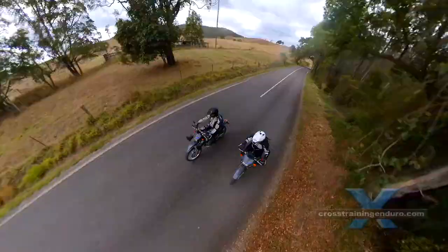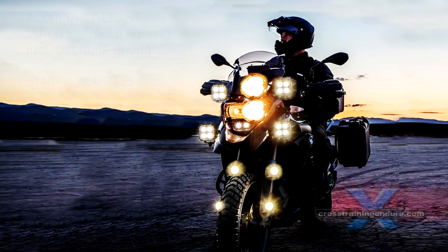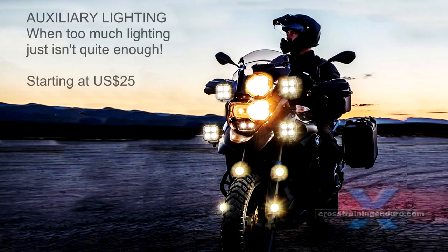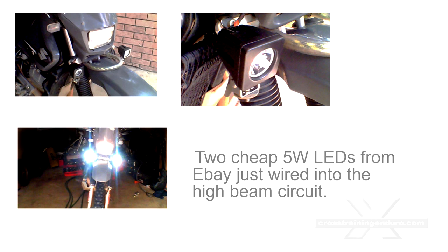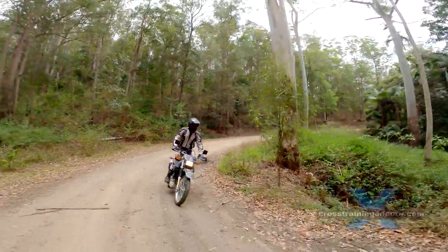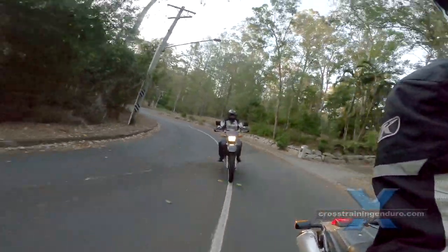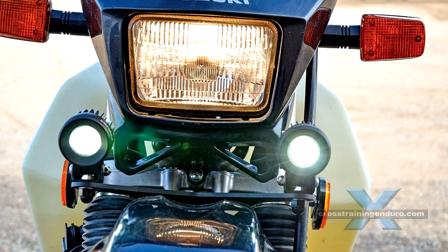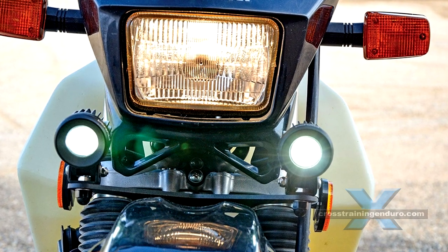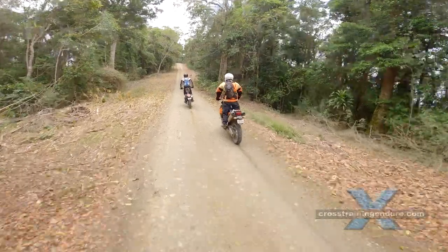But we think it just makes sense to spend a bit more and go LED. Next, auxiliary lights. There are very expensive kits out there, but you can do it very cheaply too. For example, we spent just $30 for two 5 watt LED spotlights, wired them into the existing high beam for plenty of extra light. If you run something like the Cyclops H4 LED bulb, you can then mount two 15 watt spotlights and use the stock wiring — this would provide a crazy amount of light. There are plenty of options: light bars, one or two spotlights, and you can choose narrow or wide beams.